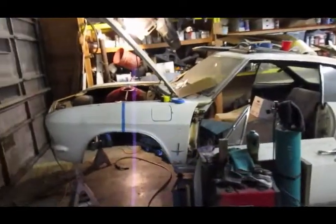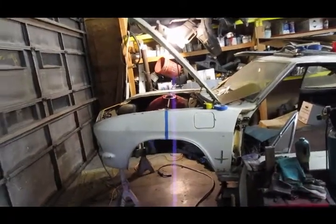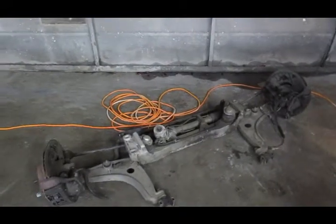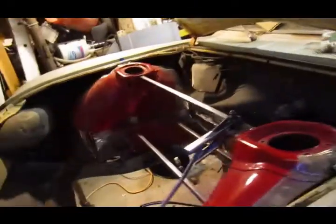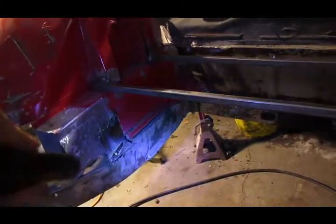As I mentioned in the intro, this car is getting a Porsche 944 suspension. Right now I'm working on the front suspension — this is the front suspension out of the 944. It's all aluminum: crossmember and control arms, nice disc brakes, and it's got the sway bar. To put this suspension in the car, I cut out the front shock towers out of a 944, and then cleared all the metal out of the front of the car here.